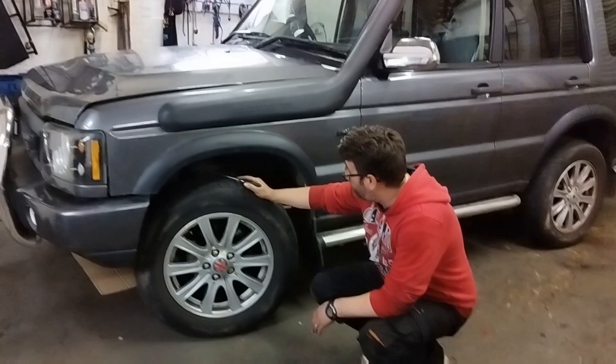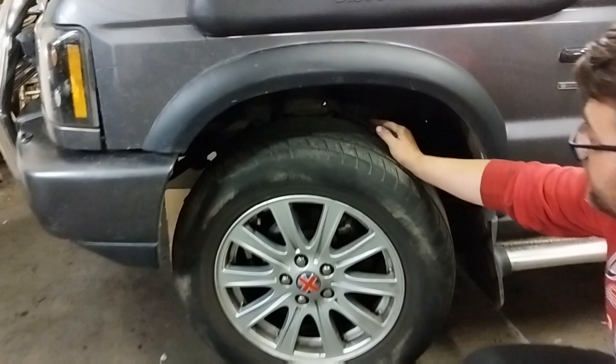Look around your windscreen as well, because up here they can start leaking and get rusty. Look for rough spots and gaps, because they will leak up there — same as they'll leak on the sunroof. You can get down with a torch and look around the bottom. Inside the wheel arch is the suspension turret, and they can start to rust around there. This one is starting to delaminate. To replace them it's about £45 each and you'll need two — it's a bit of a nightmare job.